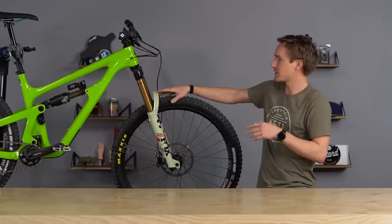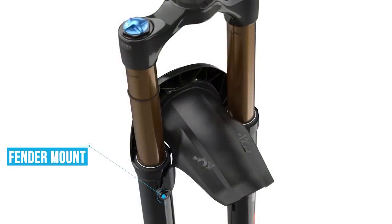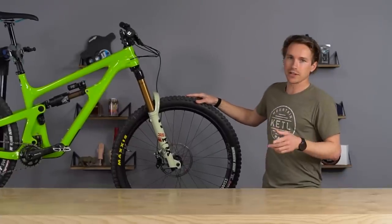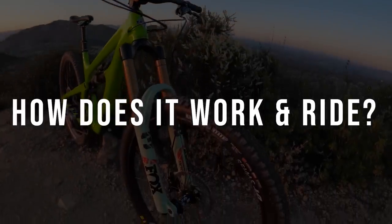The brake arch is now redesigned with more clearance, so there's more fitment compatibility on bikes with larger head tubes. It now has threaded holes in the back so you can bolt on a fender — Fox now makes bolt-on fenders for all the forks, which is awesome. People have been waiting a long time to get rid of those zip ties. Check the link below for more details, but more importantly let's talk about how this thing works and who it's for.